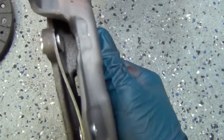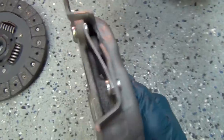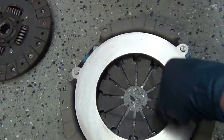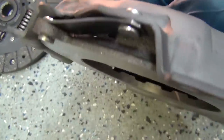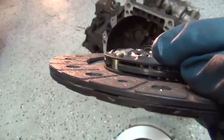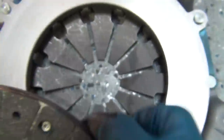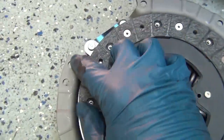The pressure plate has got three springs — you can see that spring steel, it's a little bit different color. There have been designs where there's a little coil spring on each individual lever. The way these levers work is they go down inside and pull up on this — this is one end of the Oreo cookie, this is the cream in the middle, this is the disc. And you can see it looks kind of like a brake pad or a brake shoe, and it's got that material on both sides.